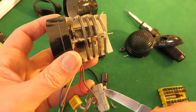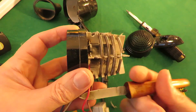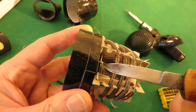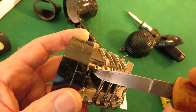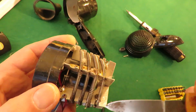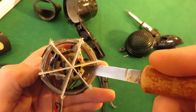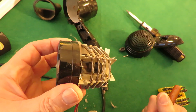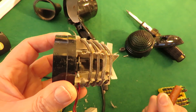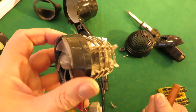And then if we push this all the way up, instead of coming out on the brown lead it's coming out on the red lead, and the red lead bypasses that big diode. So you're getting the full AC up and down, which is being rectified to DC there. So half power is half the AC; full power is the full AC. That's interesting.